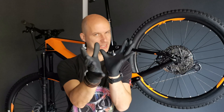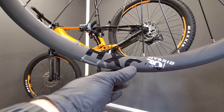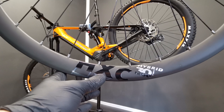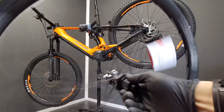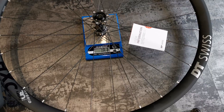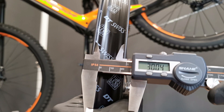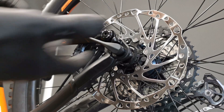But first let's see the new wheels. The front wheel: DT Swiss HXC 1200 Hybrid 30 straight pull. The rear wheel as well: DT Swiss, same model HXC 1200 Hybrid 30 with the famous ratchet system. I prefer the silent ones though. Both wheels are tubeless ready. The front wheel is a 29er at 783 grams, the rear wheel 27.5.